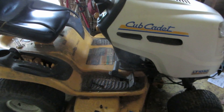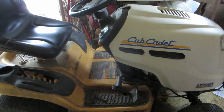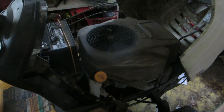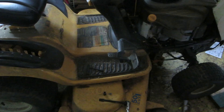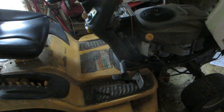This is the first video of 2015 that I'm posting to our main homesteaders Facebook page. It's about our Cub Cadet LT 1050 — we've developed an issue with starting. This unit has a Kohler motor, and last year it started turning over real slow. Research I've done online indicates this is a common issue for this motor, and I found a forum where a guy described how he cured the problem: replacing the starter.